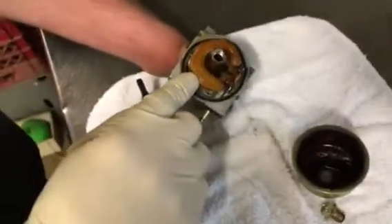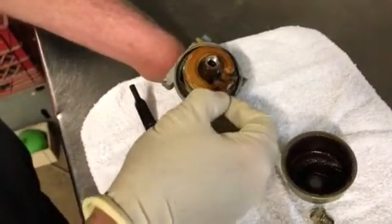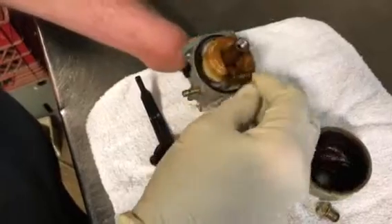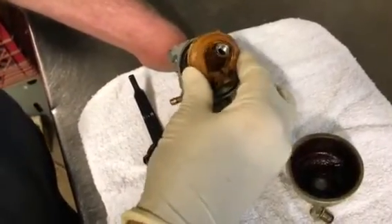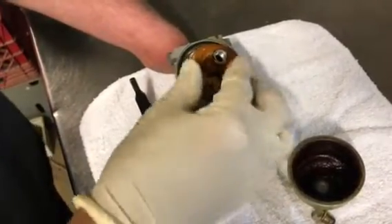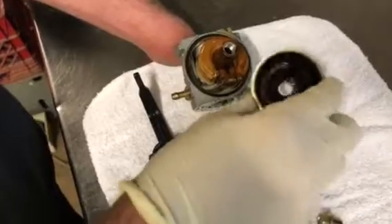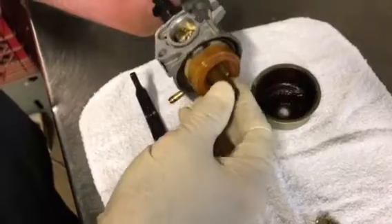This is the float, and there's a needle in here that regulates the flow. So you pull the pin out and this float should come right off — but it doesn't. The needle inside is stuck. We're talking really, really stuck; I don't think I'm going to get it out without ruining it. This is worst case scenario — this is real sticky, this is gooed up. This is what gas comes to when it sits in small quantities. This carburetor is so gummed up, and there's a jet inside here that we're not even going to be able to pull out because it's so gummed up.